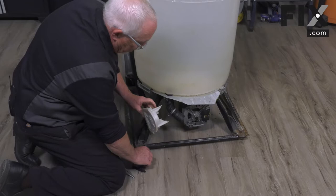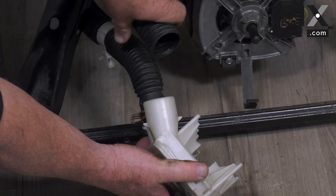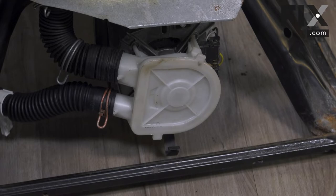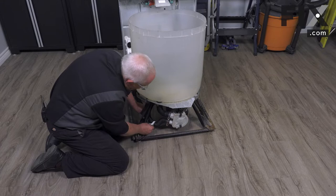Now we're ready to install our pump. Insert one bracket into position by lining the slots up and rotating it to hang down. Put the hose on, then introduce the pump onto the motor shaft. Take the top clip, turn it into the motor the same as the bottom one did. Don't forget to put your clamp on that hose.